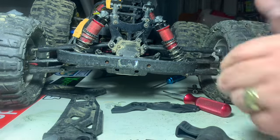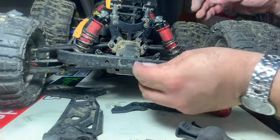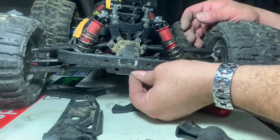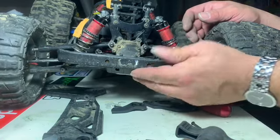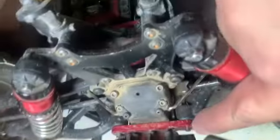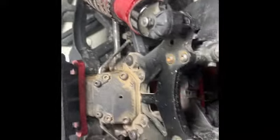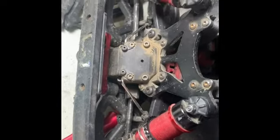Yeah, that's a pretty long one. Let's see if this one can go in there. Because you understand, without these screws here, these pins will fall out. You can see the threads of the screw. So this housing has been broken. So eventually I'm going to have to look at an upgrade of these diff housings. Maybe change those to aluminum. I don't know. Let me know.